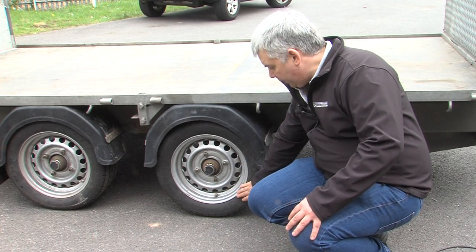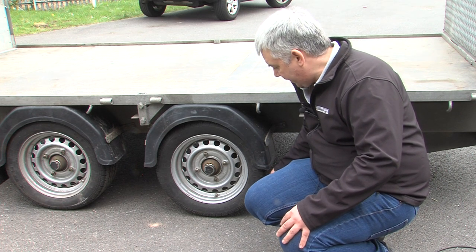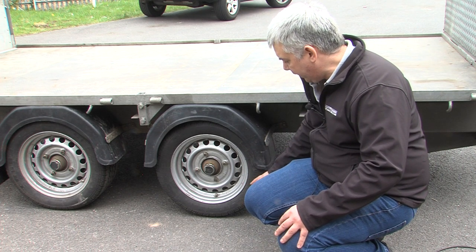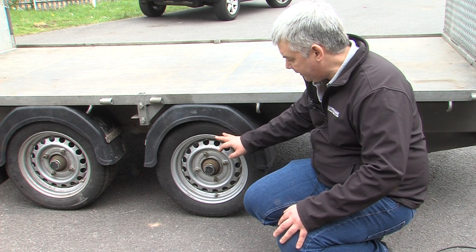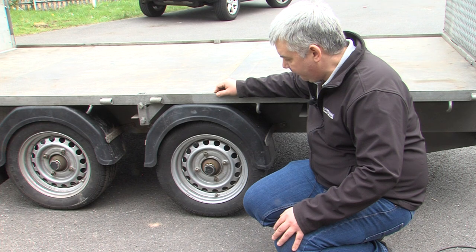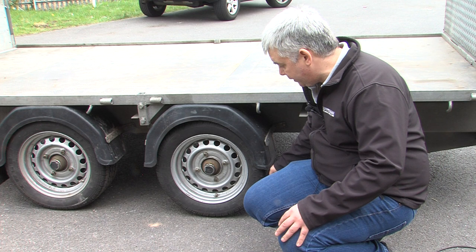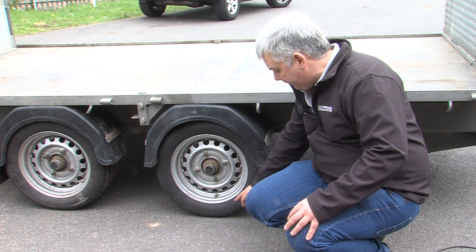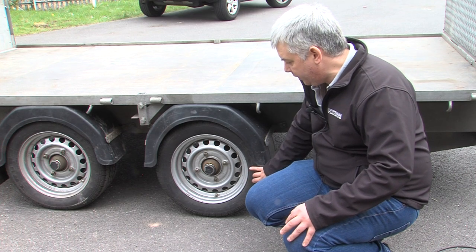This tyre will be changed next year as it will be reaching five years old. Check the date, check for perishing, and then simply check the tread. It's quite easy to run up costs with wheels and tyres if they need replacing — a commercial tyre like this one can easily cost £80 per wheel, which is over £300 for a set of four. Normally trailers have decent tread, but because they're not getting much use it's often the age and perishing on the sidewalls that means you require new tyres.